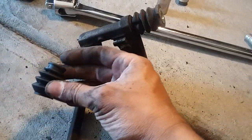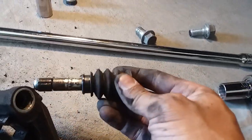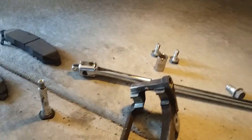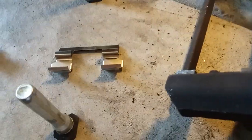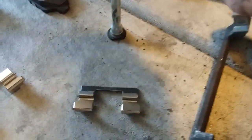I'm going to replace these boots as well and re-grease these pins. They just pull right out. Wiped off the pins, hit these guys with the wire brush — really just worried about the surfaces where everything contacts. Slip this guy over.